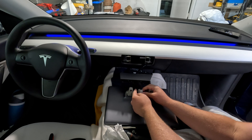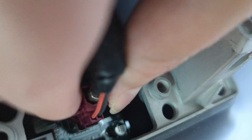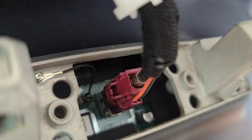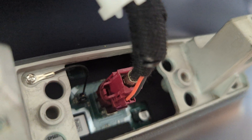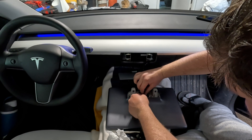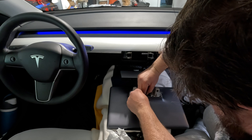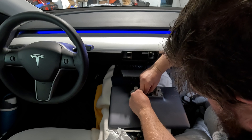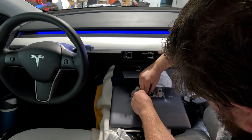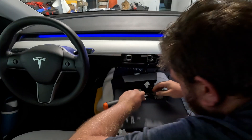We need to take off this plastic first. If you press on one side and pinch or bend these two, it comes off. The purple plastic has a lock on the side — a small piece you need to press. Press that and start wiggling the plastic piece to get it out; it does disconnect at that point. Hold down that piece of plastic, don't pull on the wires, and slowly wiggle the connector. If you wiggle it while pressing that lock, it should pop off. Press it a little with the screwdriver if needed.